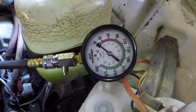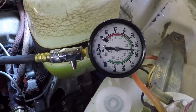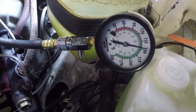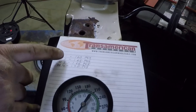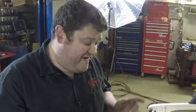We test number three — good — and now we're on to number four. Wow, we're good — that is amazing. Now let's review the numbers: our lowest number was 160 psi, our highest is 170. High numbers are nice to have; anywhere from 120 psi up is usually pretty good. That's actually pretty phenomenal especially for what this engine is.